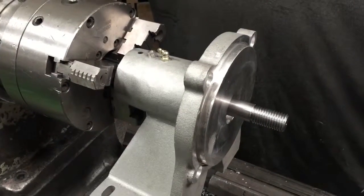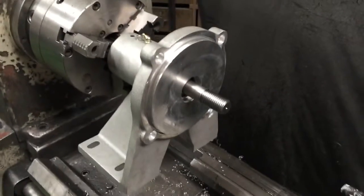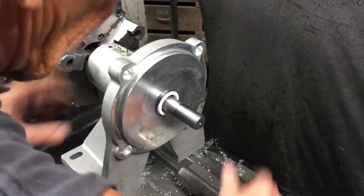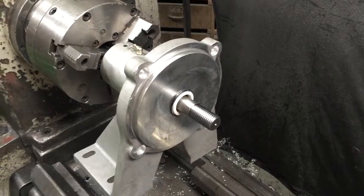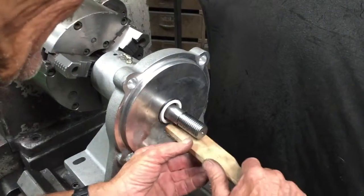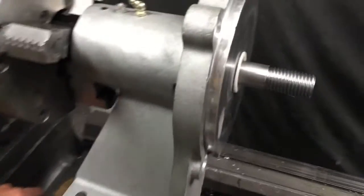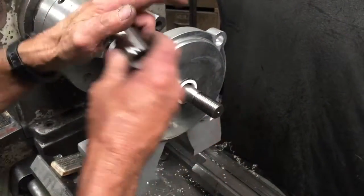We went ahead and chucked it up in the lathe, but a vise will work too — anything to keep the shaft there and keep everything nice and straight. Ronnie is putting in the white ceramic seal, which is the pump seal — the part that most commonly fails on the pump. It's very important that it's seated all the way to the bottom. Push it with a block of wood or something soft so you don't chip the ceramic. If you chip it, you've got to change it. Look at it from the side to make sure it's nice and straight.